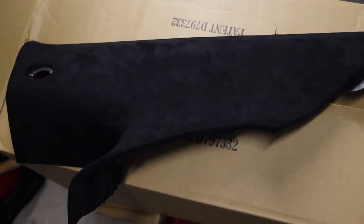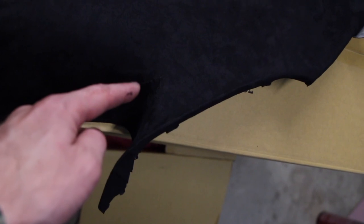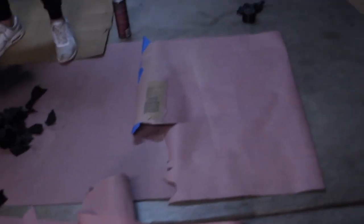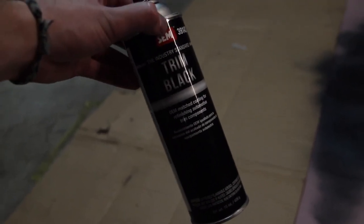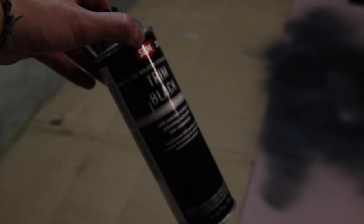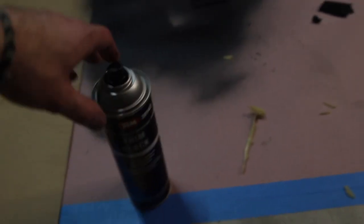We are partially done with the rear pieces. Both are very difficult because of the sharp corner. To make the fabric not crease, we had to cut out another piece in a triangle form and put it in between. We'll clean up the edges a bit more. We did the front ones and painted all the gray pieces black. We used a really good trim black paint — two coats and it's done. It looks great and lasts a long time. I've used it on my M3 for over a year and it still holds up.